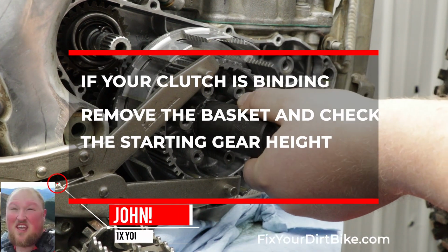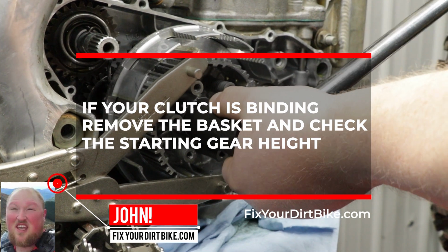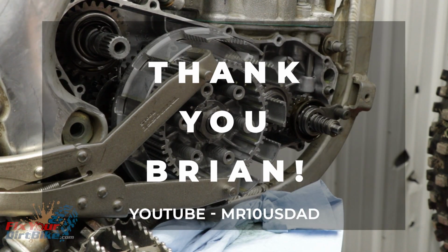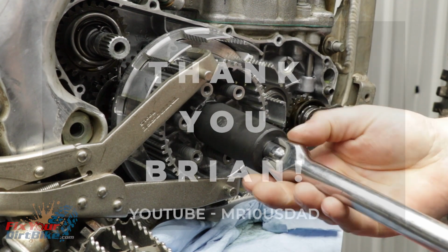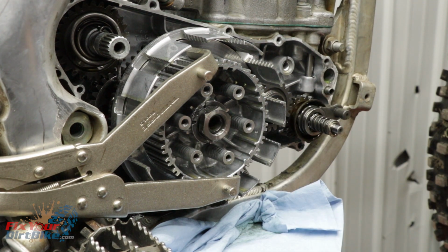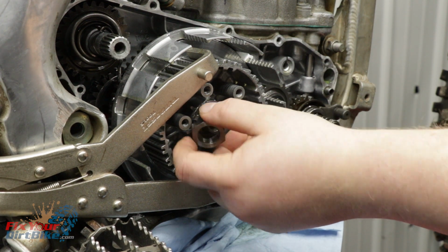If your clutch is binding when you torque the center bolt, pull the outer and check how far the kickstarter gear is sticking out from the back of the basket. I want to give a huge shout out to Brian from Georgia for figuring out a problem I didn't even know existed. Brian was experiencing this binding issue, so I asked him to send me a message on Facebook so we could troubleshoot with pictures and video, and we found the thrust washer was definitely worn out.